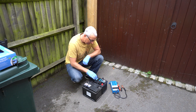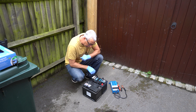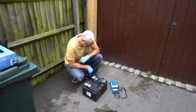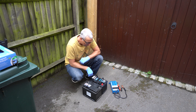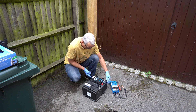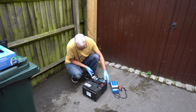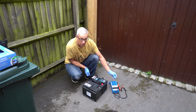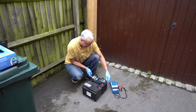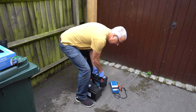Put the new battery next to the old one. The first thing you want to check is that they look physically similar. It's the same battery type, so this looks pretty identical in terms of size. If it looks wildly different, check the part number before you even get this far. Keep the terminal covers on for now. Note that they sometimes have transit plugs at either side — this one was bought mail order. You need to remove those; that's for the battery venting system on lead acid batteries. Very important to remove those.